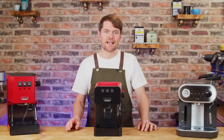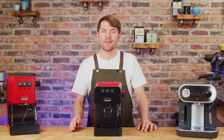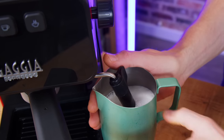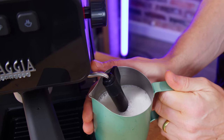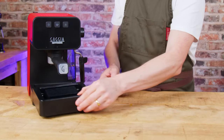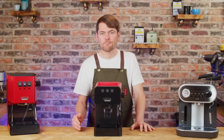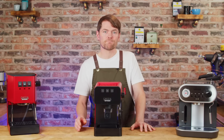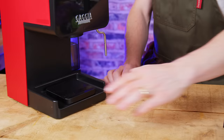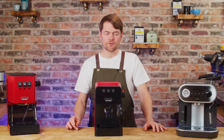Warm-up time is about 25 seconds, and steam-ready time from pressing the steam button is also about 25 seconds. There is an auto-off on this machine but it's 30 minutes, not 9 minutes as with the Carezza. It has a Panarello steam wand with a couple of surprises. The drip tray capacity is about 275 millilitres — pretty good for a small machine — but it's chunky so the max cup height is only about 7.5 centimetres. Slide it out and you have about 10 centimetres and a nice flat surface for brew scales. There's no solenoid, so you can use it without the drip tray.